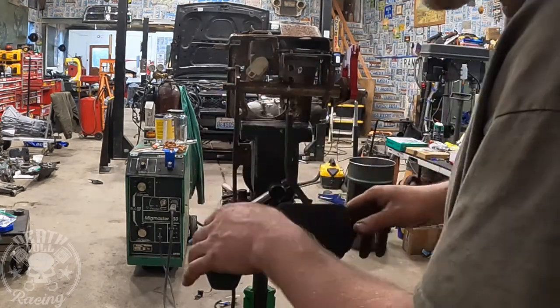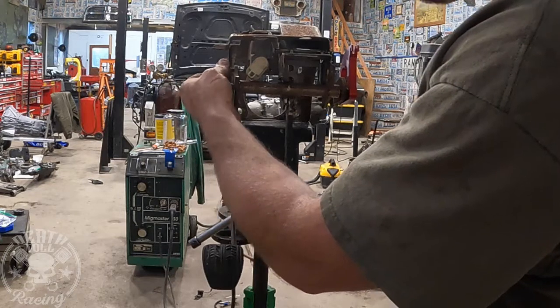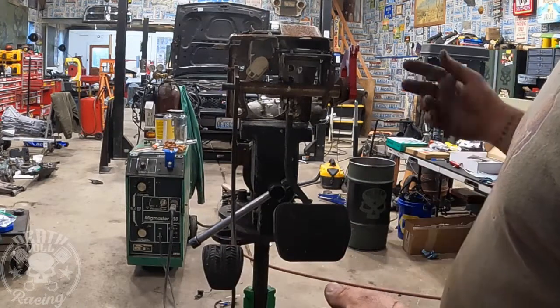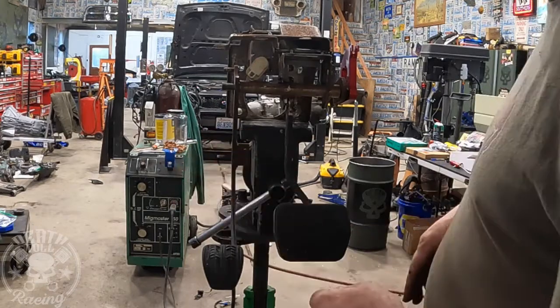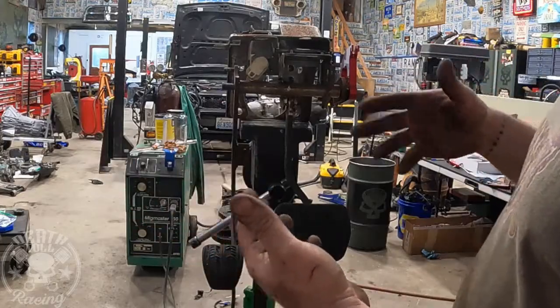The brake switch still works, which is good. So now I don't have to redo any of that stuff. And then I put this pin in the other direction. I cut it off and I'm gonna put it in that way. So I'm gonna weld that. And then we can put our clutch switch in, and put our neutral safety switch wires in line with that so that you have to push that in to start it. And that's about it. So I'm gonna box this all in, round this all off and weld it up so it doesn't look so jimmy-rigged, but it should work.